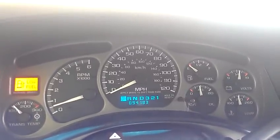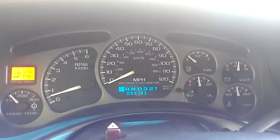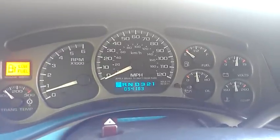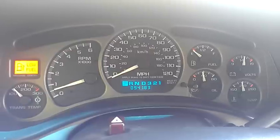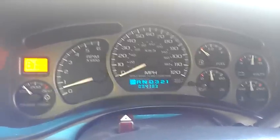There's also that fuel gauge problem, where I think it's a problem with the ground — if the tank is full and you sit still for too long, it will read empty. If I were to start rolling, it would automatically flash back up to full. But I'm not too concerned about that.